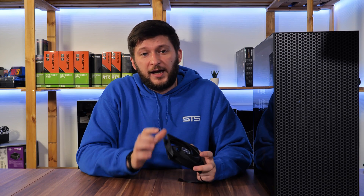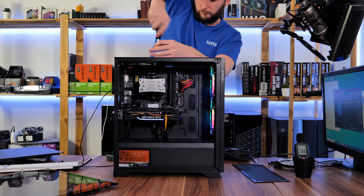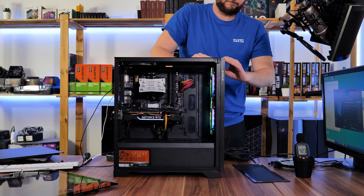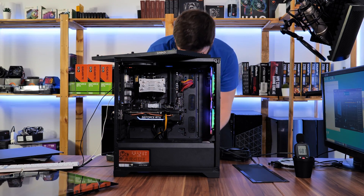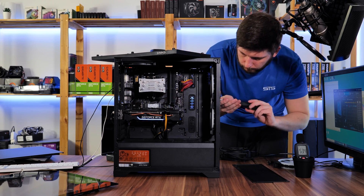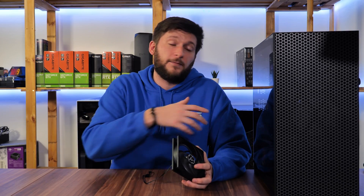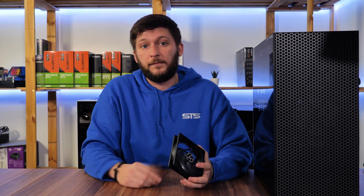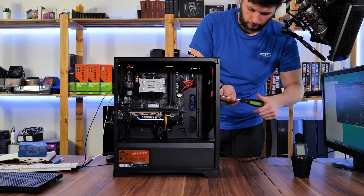To test performance, I had to do a lot of testing. From now on, we'll benchmark all fans inside the ESA Hive case. The setup uses a Ryzen 5 3600X locked at 3.26GHz with 1.1V on the V-Core and a Be Quiet Pure Rock Slim on top, but with the CPU fan removed to exaggerate the impact of case fans. For each test, two fans are placed in the front as intake and one in the rear as exhaust — except 140mm fans which needed one on top. We ran everything at 100%, 50%, and 20% PWM while stressing the CPU.